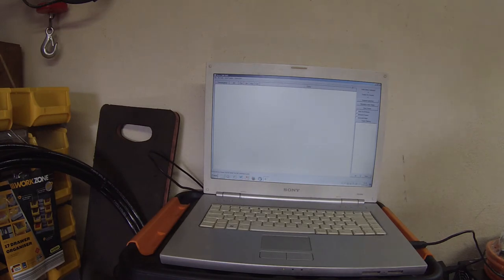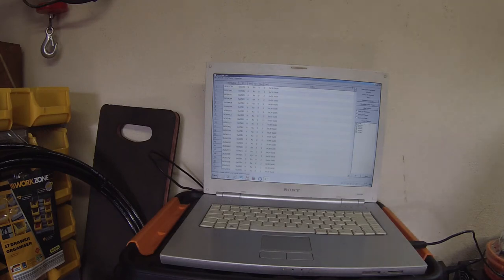What we're looking at now is SavvyCAN monitoring the CAN bus on both the vehicle CAN bus and the motor controller CAN bus. Let's go ahead and turn the ignition on. You'll see straight away we get a lot of CAN frames pumping in — I'm seeing just under 4,000 frames a second across a range of different IDs, and you may have heard a click there that occurs in the inverter. That looks to stabilise between the two buses at around 4,000 frames per second, and it certainly ratchets up fast. We turn the ignition off and that'll go into a shutdown mode, and we drop to zero frames. So that's that part.